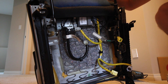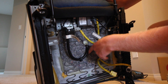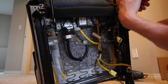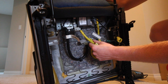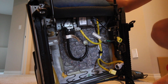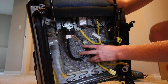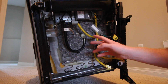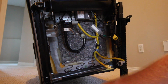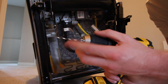We're going to start working on the bottom of the passenger seat. I've essentially just flipped it onto its back. You'll notice the difference between the passenger and driver's seat is that the driver's seat doesn't have a little piece of foam underneath. There are obviously more cables running under the passenger seat — these are all the connectors I need. On the other end, connectors are coming out of the car with nothing plugged in, which is why the airbags aren't working. This sensor determines whether someone is sitting in the seat. Tools you'll need: a blade, a couple of flat screwdrivers, pliers, and a drill with an 11/64 drill bit — you need that specific size.